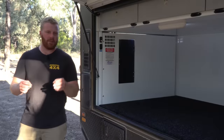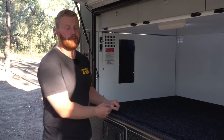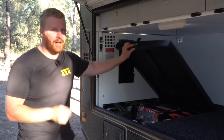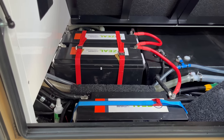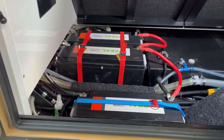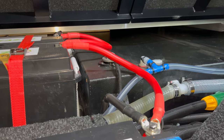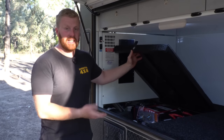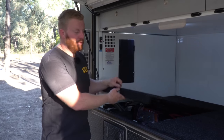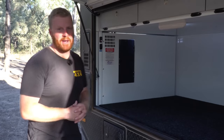There's no denying that we are running quite a power-hungry electrical setup, so to supply all of that power we are running three 200-amp-hour Zeal lithium batteries. We initially started with two batteries; however, we soon realised that induction uses a lot in conjunction with our other power needs, and a couple of days without solar would bring about power anxiety. All of these batteries are wired in parallel together, which gives us that 12-volt output, but all of this supplies some of the electrical wizardry behind this panel here.